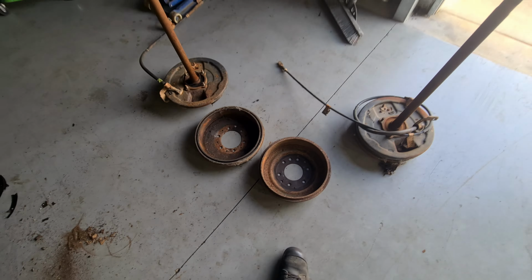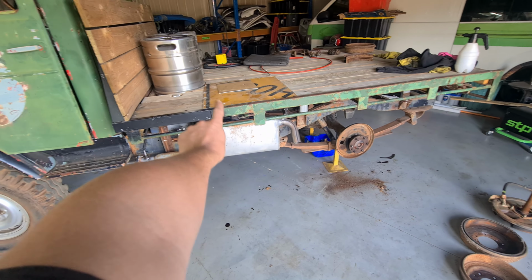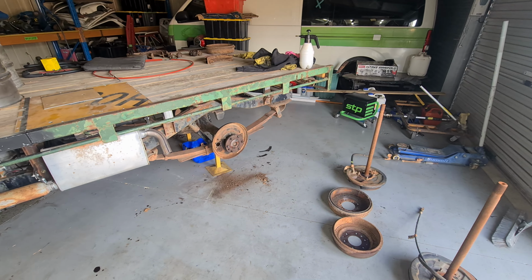They're that close, but the bolts on the diff for a Hilux are 4 stud and the bolts on the diff for the Toyoace are 6 studs, so they can't just swap over. So without changing the ends of the diff, which is a mission, we can't put the Hilux stuff on. But that may still happen because there's handbrake cables in the Hilux ones and there's no handbrake on this, and no provision for it now that we have deleted the original gearbox, because the handbrake is on the back of the gearbox.